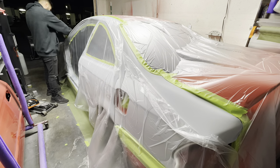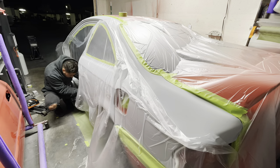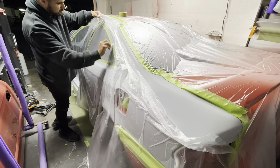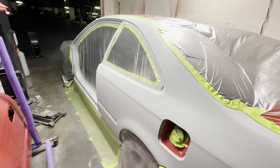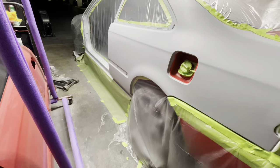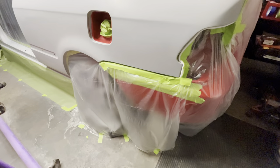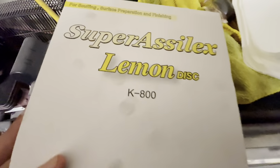I'm going to let the video run a little bit so you guys can see what it takes to actually trim this plastic down — it's really not that difficult but it can be tedious at times. After a few minutes of putting plastic down, this is what the car ends up looking like: all covered up, with the wheel covered, parts of the bumper covered, and areas like the quarter glass and door protected so paint doesn't get inside the car.